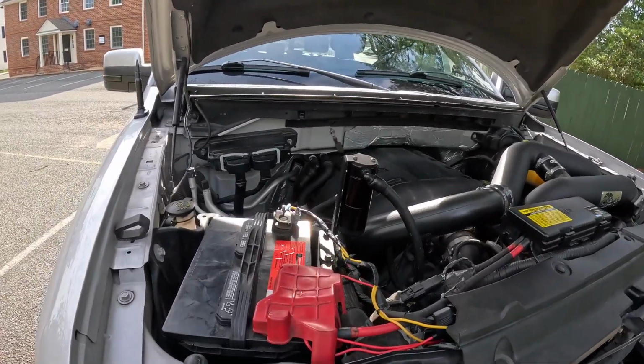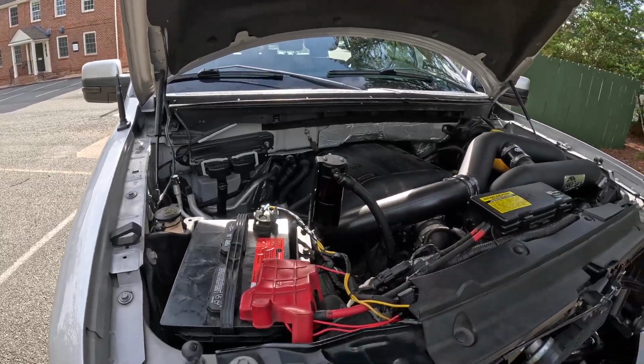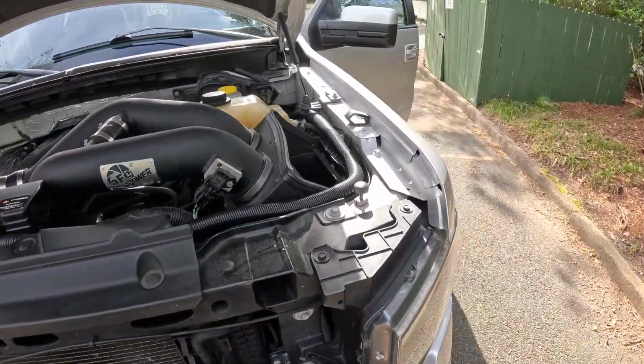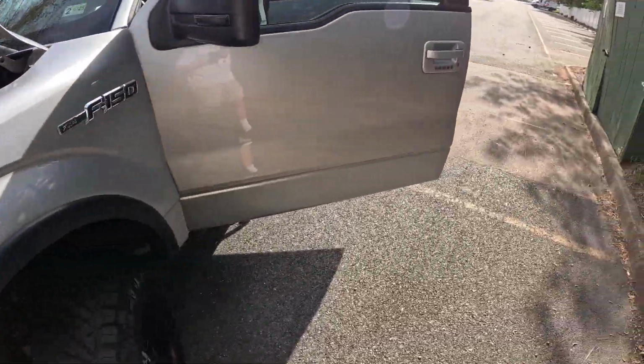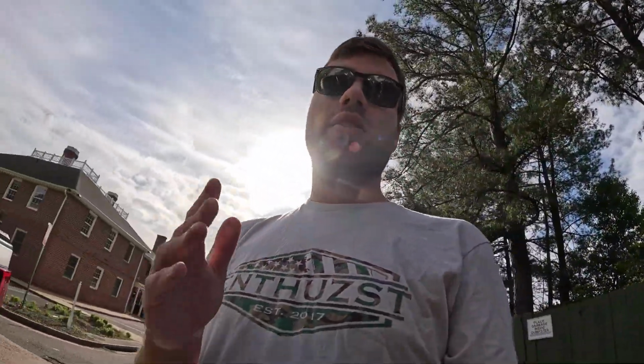It's a cheap part. I recommend getting that fixed. They only charged me like 2-3 hours of labor, so I definitely would get that fixed if you're having the high radiator fans come on when the AC's on and go off when the AC's off. Just wanted to make this quick video.